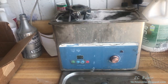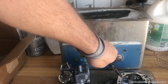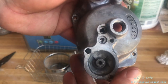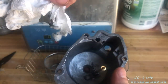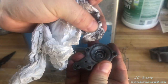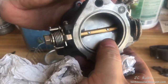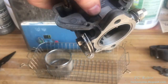Time's up. Make no mistake these are hot — I don't feel like touching them. This is just for an inspection — we'll evaluate and see how the metal is doing. As far as the aluminum I see no negative reaction — always looking out for that. It seems okay. We had all that nastiness on the bottom of the bowl — definitely took that off. I may let it sit one more round since it's definitely not hurting anything. A lot of deposits are collecting and the throttle bore area is looking very good — all that garbage is out. One more time, 20 more minutes.